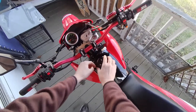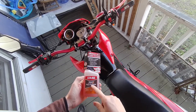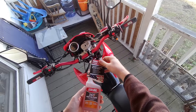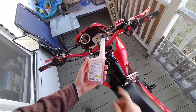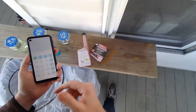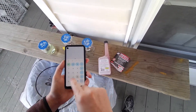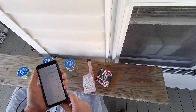I've already got a decent amount of fuel in here so we're gonna treat what's in it first. I've opted to try this out — StarTron is what I used to use, and I've got a video coming where I'm gonna test this versus StarTron versus untreated, so subscribe to check that out in the spring. We need one ounce for every five gallons; this is just under three gallons, so about three quarters of an ounce. It's like 2.7 or 2.8 gallons, so roughly 60% of an ounce — about 18 milliliters. Let's get this into the Hawk.